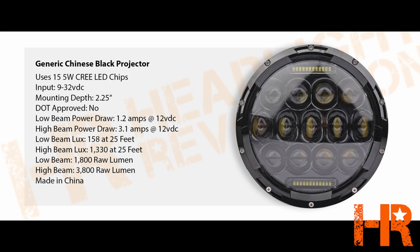At 25 feet, the maximum lux of this headlight is 158, and on high beam, this headlight creates 1,330 lux. The manufacturer's rating on low beam is 1,800 raw lumen, and on high beam, 3,800 raw lumen. This headlight is made in China and available in a black or chrome version.